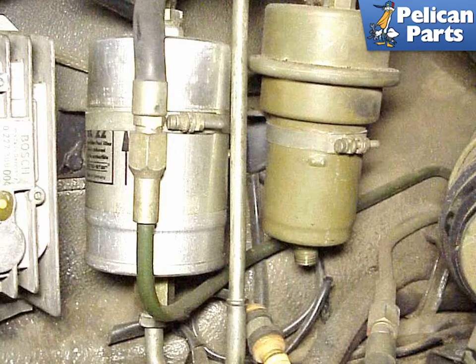Make sure that you let the car sit for a couple of hours before you release the connections. If the fuel accumulator is working, the system will still be pressurized and fuel may spray out. Make sure you're working in a well ventilated area, have your eye protectors on, and should be wearing gloves. The accumulator typically holds pressure for about a half hour, but this time may vary among different cars.